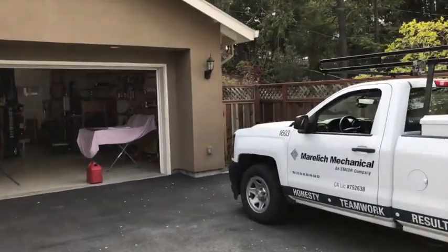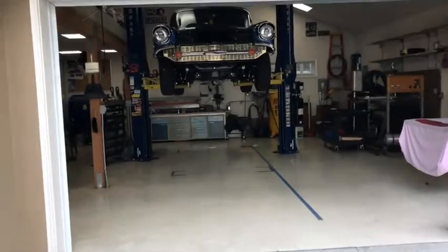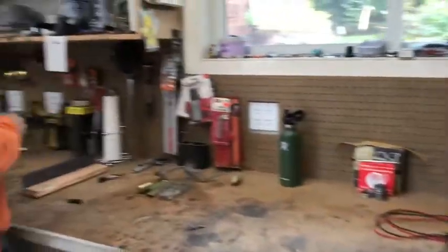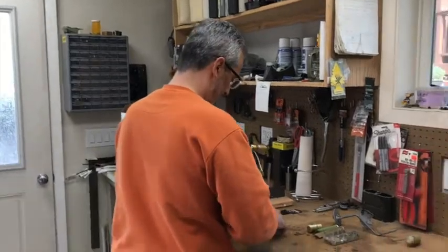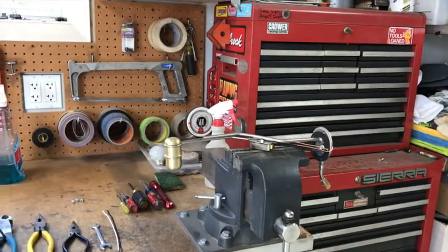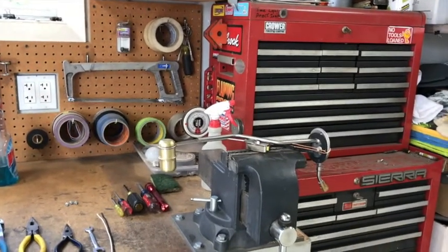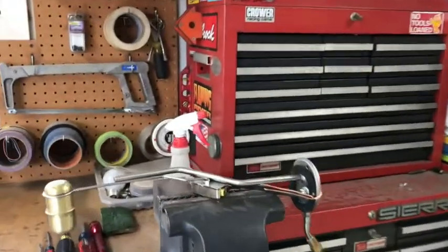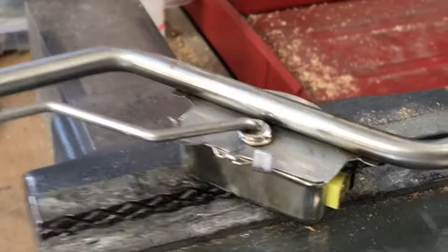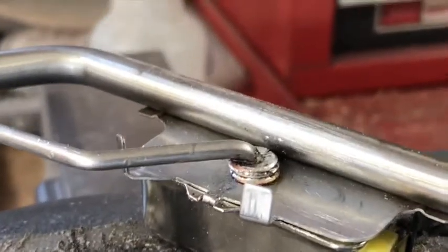Well okay, today is April 3rd, the day after the last slow and boring video that I showed you. Okay, and I got the master procrastinator/fabricator thinker here today and we've been playing with this thing. Took it out because it did the same thing — I told you it did the same thing. I put it back in with another float on it and it did the same thing — it went to two tenths of an ohm no matter that there was 15 gallons of gas in the tank. So we played with this for quite a while and I think we figured it out. If you look — let's see if I can zoom this — there, if you look at that shaft where it goes into the rheostat you'll see it's got three little washers on it right there.